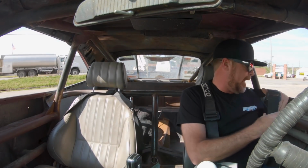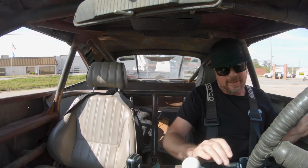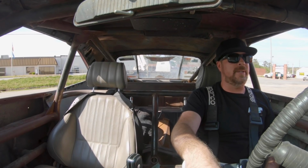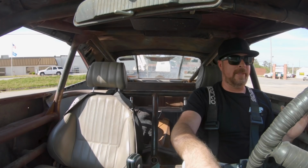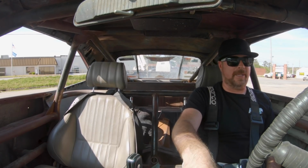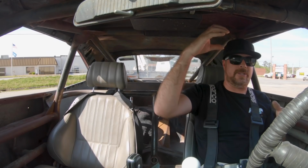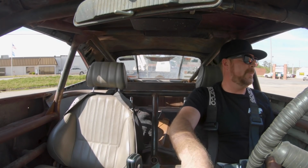This is it. Our scientific, totally, mostly accurate after brake test. This will be with the Wilwood brakes, the QA1 suspension and steering, same $70 tires, same 8-lug wheels. Haven't scaled the car yet. We'll do that when we get home. So today's goal is, does it stop shorter? It already drives better. I'm stoked on the way it drives. Need to lower it, but can't do that right now because we're out of shock shaft. Basically, we have about an inch of shock shaft showing, so it can't compress anymore. Otherwise, you're just bottomed out all the time. The only way to lower the car some more is to extend the upper shock mounts upward and get the shock to open up some more. Then we could lower the car some more. Right now, I'm not worried about that. That'll be for another day, another episode.